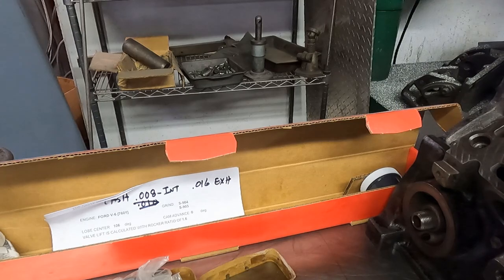Professional guys would try to measure the taper across the cam and check the radius on the lifter and start there. If you're going to have a cam go flat in the modern era, my opinion is that most of the time it's going to be a lifter problem. There's really only one big iron foundry that casts the cam cores and they know the recipe — still made here. The camshafts themselves are going to be on point. The lifters are coming from a much broader span of sources and a greater number of countries. Just because something is imported doesn't necessarily mean it's bad, it just means you have to check it out a lot closer.